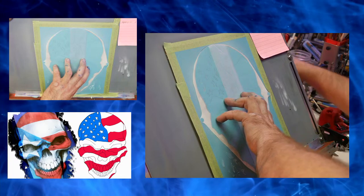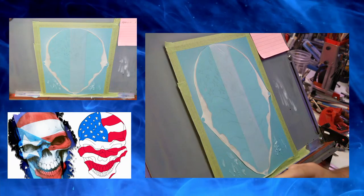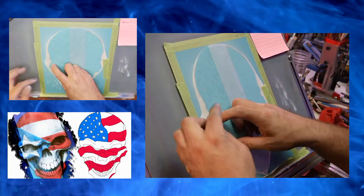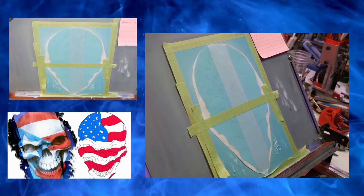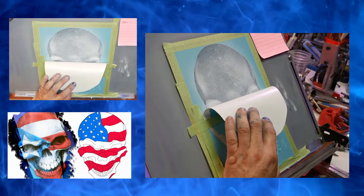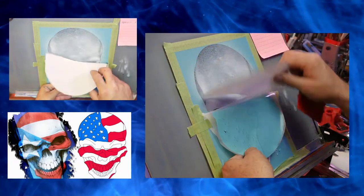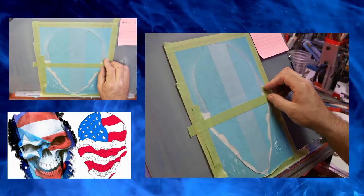And you usually try to have your tape ready at the same time. So I can go here, line you up, good, line you up. And then I do another hinge. I go right across the center, grab my squeegee. This paint should be dry enough now. And that's the other thing, I don't go too wet or too dry. If you're worried, you can check it. You can always tack it off as well. We'll pull this guy back. We'll lay that in place.